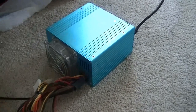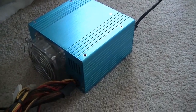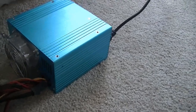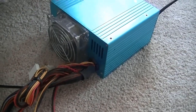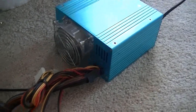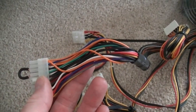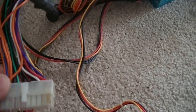Using an old power supply — obviously the power supply has to work — but you can't just plug it in and turn it on, because they're not designed to work that way. But it's a very simple sort of hack to get it to work. Normally, this connector here is plugged into your motherboard on your computer, and it provides the switching to turn the power supply on.